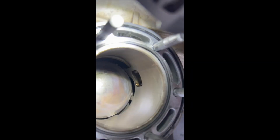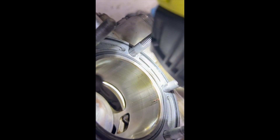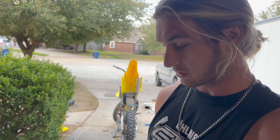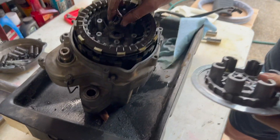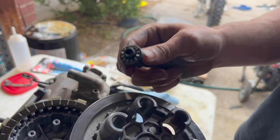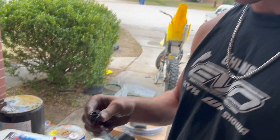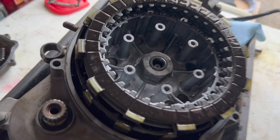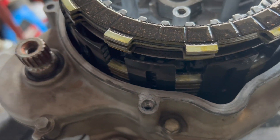This piston looks good, it's clean except for a little bit of carbon — not bad. If we pull this down and shine a light in here, the cylinder doesn't look bad except you can see there's a spot right across that bridge and it doesn't have any cross-hatchings. So I'm pulling the clutch out — we're just going to strip everything down, transmission and all, and inspect it. Underneath the clutch pressure plate there's supposed to be a washer on top of the roller bearing and there was not. You can see it has cut a groove straight into that. Whoever assembled this last did not put that washer in. That's probably where all that silver metallic material inside the motor came from — it could have ended up freezing up at some point, which would have been bad.